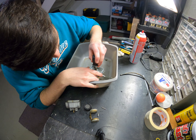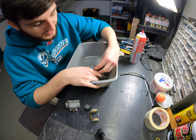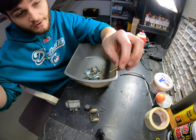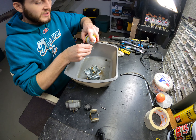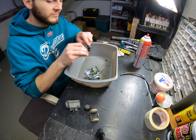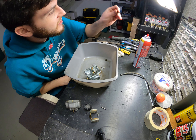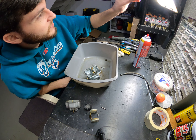I have another one here that will probably work a little better, and it does — so make sure you can get all the way down into the well of it. Give that a few spins; you can usually take it out by hand at this point. This is the needle jet — it is clogged up a little bit, so we're going to go ahead and clean that out. Usually I spray a little bit of carb cleaner on there; any brand is fine. I usually use a soft bristle brush, nothing metal because this is brass and I don't want to damage it. Give it a blow through and check the hole on it — this one is a little bit clogged. These side passages are a little clogged as well, so we'll get those cleaned out.